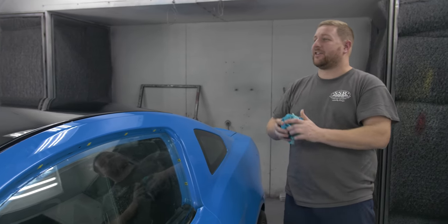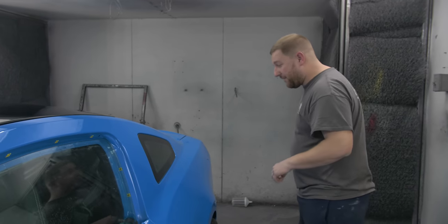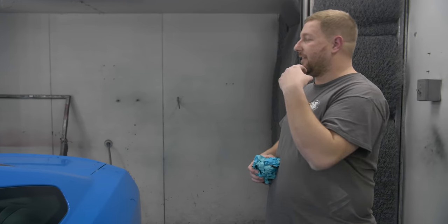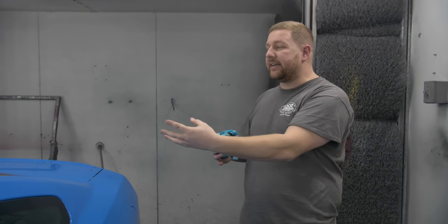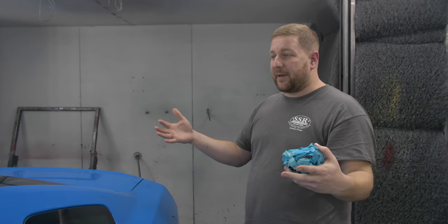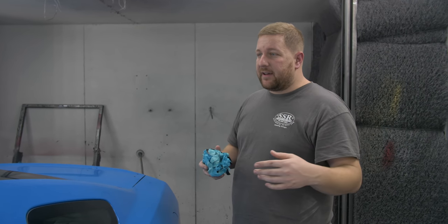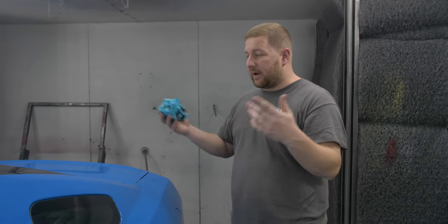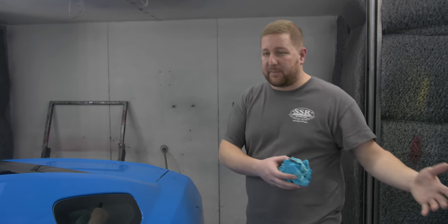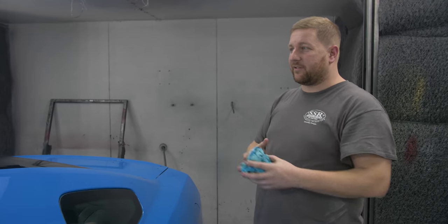with proper adhesion. This paint is leaps and bounds gonna last way longer than factory paint because it's thicker, it has higher solids, it's designed to last years and years on show cars. I've had multiple customers with bumpers that we've painted and they don't get them PPF, you know, for whatever reason. And they come back to me a year later and say, I want my other car painted because my factory paint chipped, but this didn't chip. This paint is worth it because it lasts a lot longer than factory.